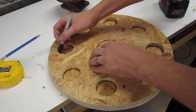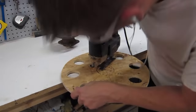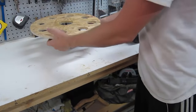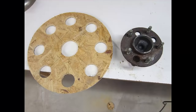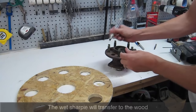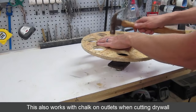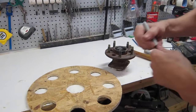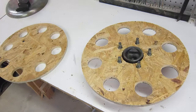So I don't have to re-measure or re-draw anything, I'm just using a Sharpie and tracing all the holes that I already drilled out. That's the center section cut out, and I just need to drill these holes and it'll fit right over that. A real quick way that I transferred the marks: I took a big Sharpie, marked up the ends, set it on there aligned with that center hole, and took a hammer. When I hit it, that mark gave faint impressions that I can mark for the holes to be drilled out — and I got five of them. I just got done cutting out the holes for the hub bolts using a half inch bit.